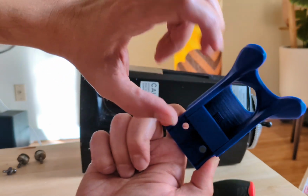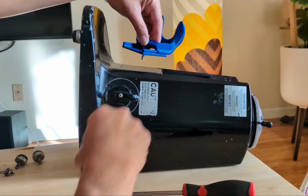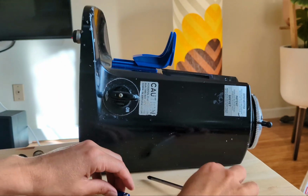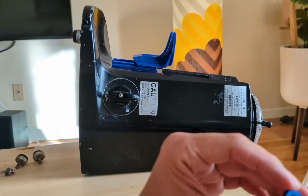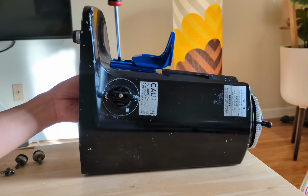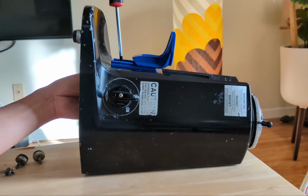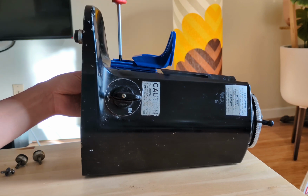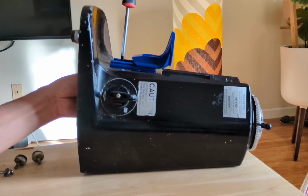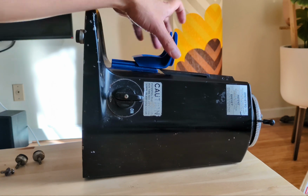You might have to make a little space for the screwdriver. Lift that up, move it up out of the way a little bit. Drop in your screws, mash it up into the hole. We're going to take our nut bar, the smooth side faces up. And these don't have to be very tight. They just need to be snug because these are nylon lock nuts. So that means during vibration, they won't come loose. Just get them in there so they feel secure. And if it's done right, you should have no gap on that sled.